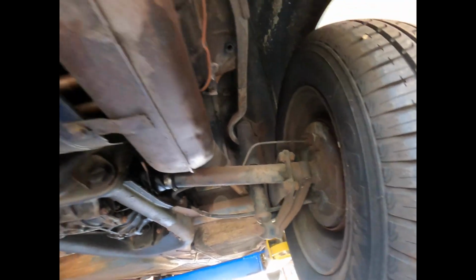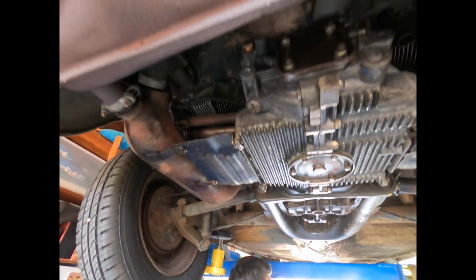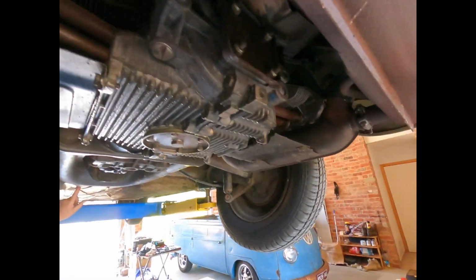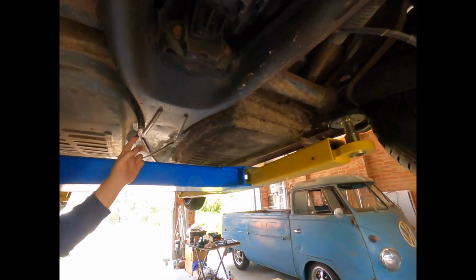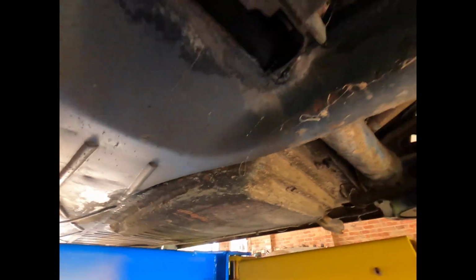Not blowing smoke, so the bores are good. No, well I noticed up behind you there was no smoke. And good compression. Got up the hill at 75 kilometres per hour, which is Moke territory. There you go. This has only been done not that long ago. Doesn't look like the pushrod tubes are leaking. No, there's some sort of leak here, grease. But it could be the same stuff from the front. It looks greasy all the way through, yeah. It looks greasy.